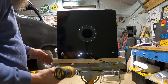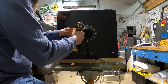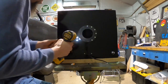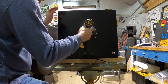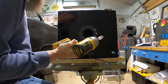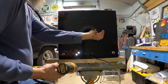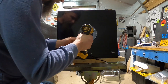If you're really having the kind of problem where you're starving for fuel, maybe you ought to look at adding a cofferdam or something inside the fuel cell. But I think we'll be all right — we'll just make sure we've got plenty of gas in there before we launch. I certainly don't want our fuel system getting clogged with pollutant. This foam is not very good foam, and I don't know that there's a better sloshing foam out there — you guys could let me know. For now we're just going to take it out. A couple of people told me they had no problems after they took it out and didn't have to do anything in return.